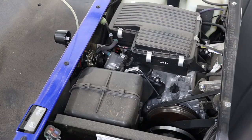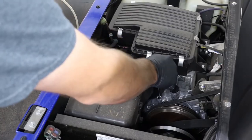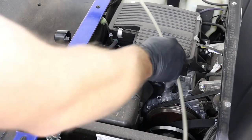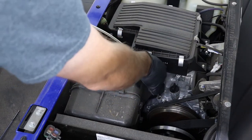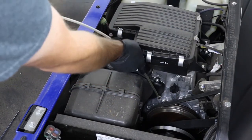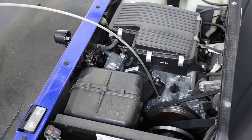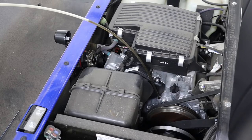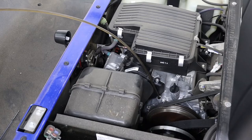You're going to be installing the oil extractor through the dipstick tube. First thing you need to do is remove your oil dipstick and then find the correct size tube that came with your extractor that will fit down that dipstick hole. Shove it all the way down until it bottoms out — that's hitting the bottom of the engine. When you start pumping, it's gonna suck all the oil up. I usually pump it about a half a dozen times to get it going, and then you can let it pump while you're doing the rest of the service on your cart.